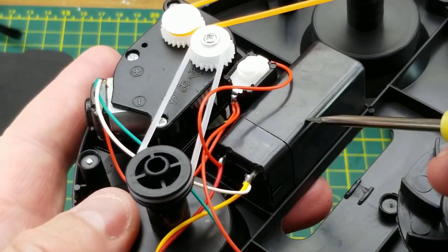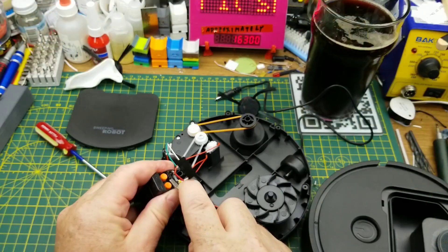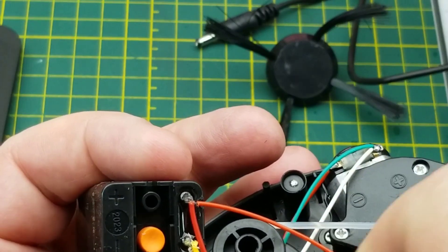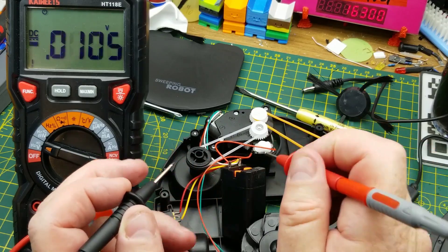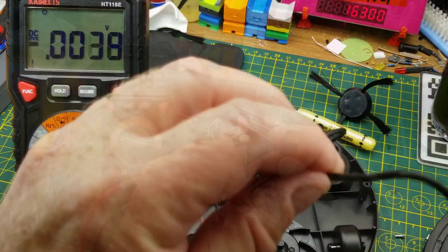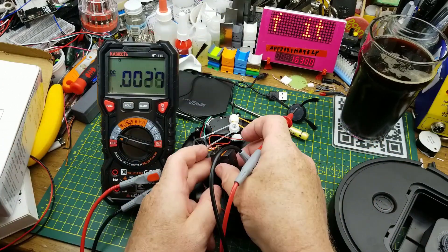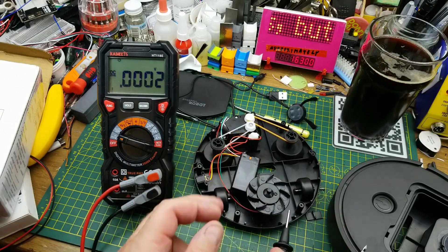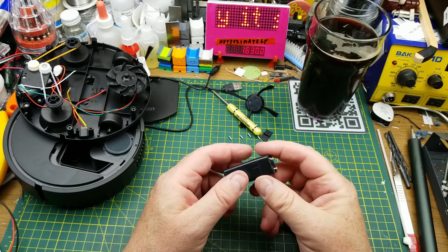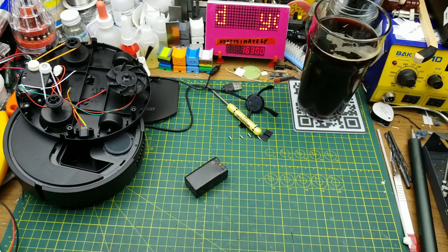In this little container here we have the battery — pops out nice and easy. We have a couple of terminals underneath. It's measuring 4.27 volts, so that is a lithium-ion battery, and it's wired directly to this little monstrosity. Unless this thing has a voltage drop or charge controller in it, it's just going to be cooking that battery. It looks like it's welded together, so I can't get into it without completely destroying it, which is a little disappointing.